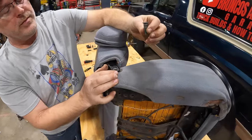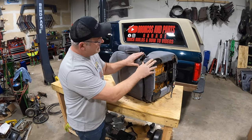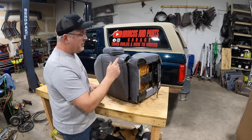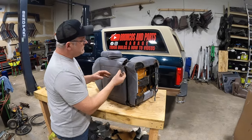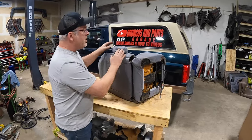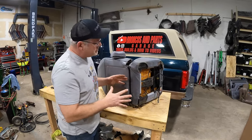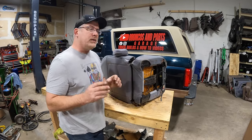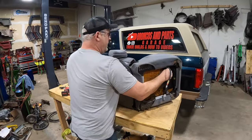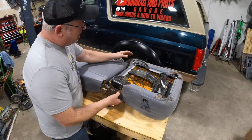Take the screw and set it aside. We've now removed the mechanical fasteners between the seat pan and the seat back. The only two things remaining are your lumbar air lines, which we don't want to cut, and your armrest up cable. A lot of people will cut this cable — what it does is simply raise the armrest up when the seat slides forward so it doesn't hit your shifter arm or steering wheel. We are not going to disconnect any of these lines or cables.